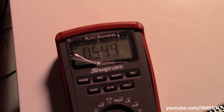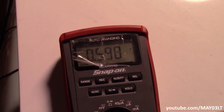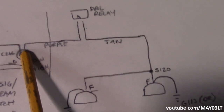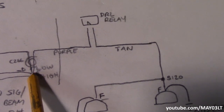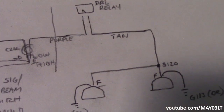The purple wire right next to the yellow wire is the one I'm testing now for the E to F measurement. I turn the headlights on — and now we're down to like half a volt. E to F was 0.5 volt. When you isolate this part of the circuit after it becomes a purple wire at C266, technically this transition takes place inside the turn signal switch. We've only got half a volt on this side.